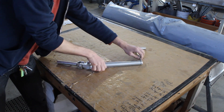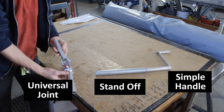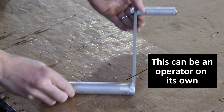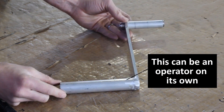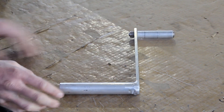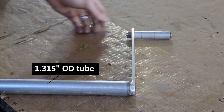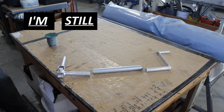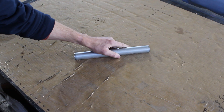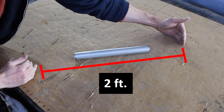Before we attach the handle to the roll bar, let's blow it up and take a look at its components. We have a simple handle, a standoff, and a universal joint. It's worth mentioning that the simple handle portion can actually act as its own economy version of a roll-up side handle, and I'll have a link in the description for a simple handle as well. A simple handle on its own is more rudimentary — its downside is it doesn't have a joint — but a roll bar one-and-three-eighths-inch tube does slide over the end of it, and you can use it as a super economy option. The default standoff is one foot, but if you want a longer standoff using one-and-three-eighths-inch tube, you can make it one foot, two foot, three foot, or whatever you need.